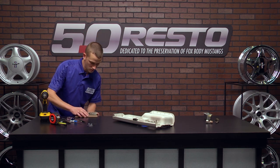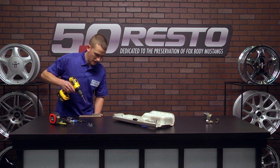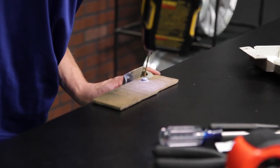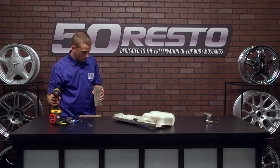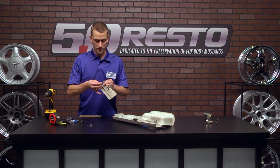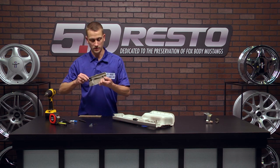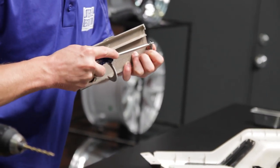Place your ashtray door down on the bottom and grab your power drill with the eighth-inch drill bit. Center yourself up where that tab was and go ahead and drill that out. With that clear, you can check the fitment of the screw — slides right through, we're good. From the inside out, put the screw through and then put on one of the clip nuts and tighten that down, because essentially this screw just became your new stud. Much stronger — it's not going to break.